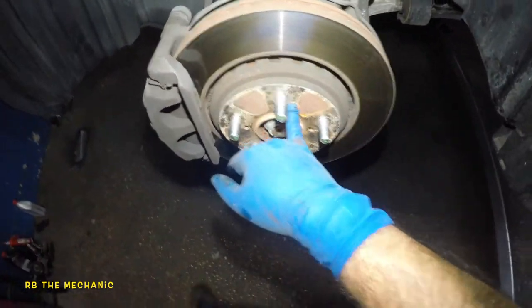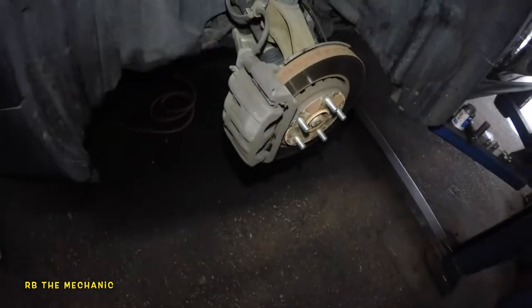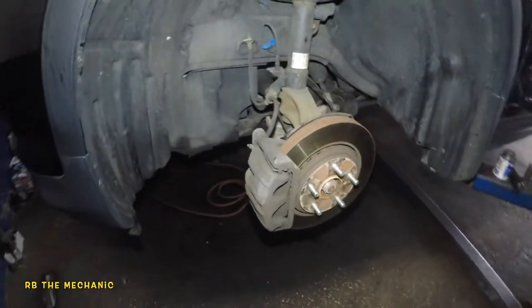What we're gonna do is remove that bolt right there — that little screw. This is a 17 millimeter. We're not gonna take off this one, but we are gonna take off this one. In the back you have a 21 and a 21 for the bracket — they're all gonna come out, and we're gonna replace these pads and rotors together.